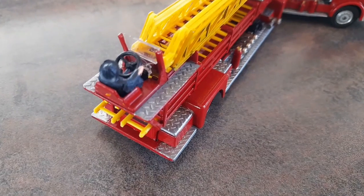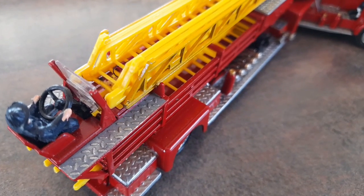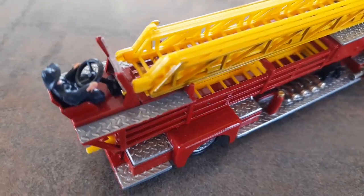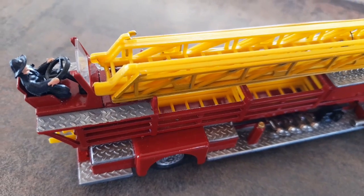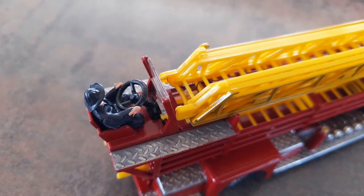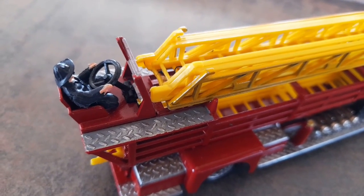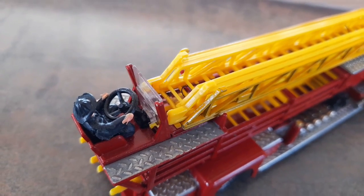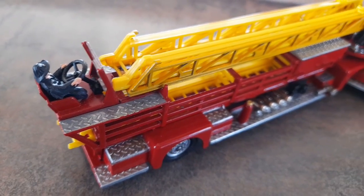A man in the back with a window, and I had a subscriber who asked in the comments how I got this little window out the back here. You have to take the steering wheel out at the base, pop that steering wheel out first, and then there's a little push clip at the bottom of the glass. Just pull it and it lifts out. But be careful because it will break.